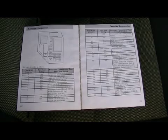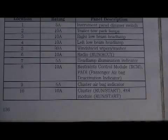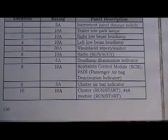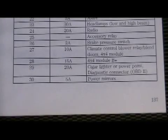There are two fuses I need to identify. The first is that of the airbag control module, which in this case is fuse number 8, a 10 amp fuse. The color chart indicates a 10 amp mini fuse is red. The second fuse of interest is the data link connector, or DLC, which in this case is fuse number 29, a 20 amp fuse. The color chart indicates a 20 amp mini fuse is yellow.